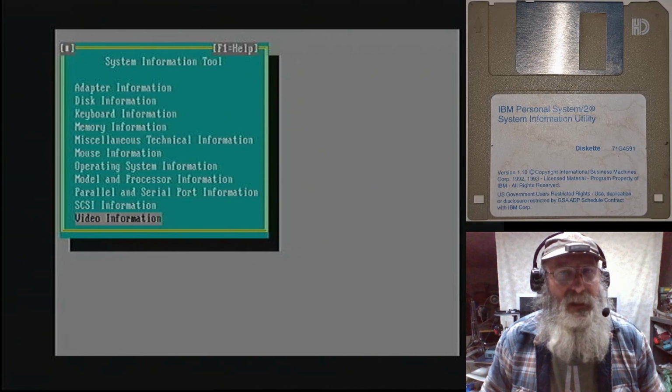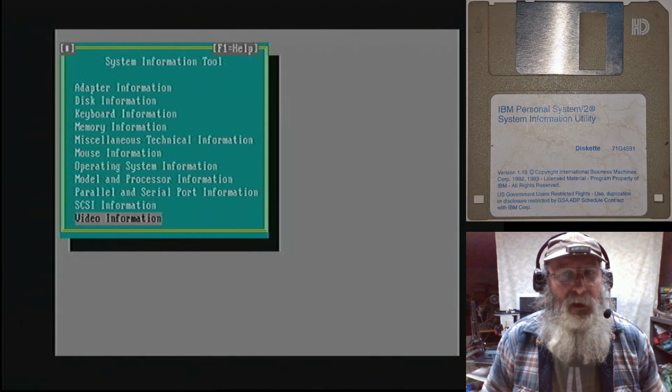And IBM just had to stick to that 8.3 DOS convention. So they spelled it as SCSILEVL, since they didn't have the ability to put in that extra E in there. With that being 9 characters, they had to have the file name 8 characters or less.